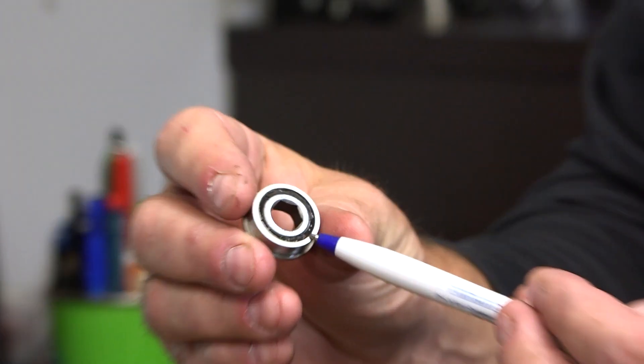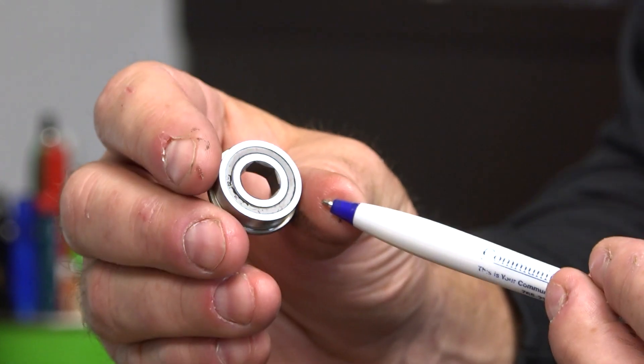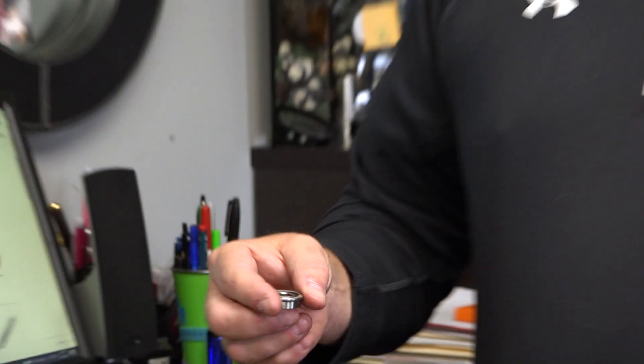There was a problem with it and it started breaking — the inner race was very thin. So we worked all that time diligently to make the inner race thicker so this will work. These are sealed, not shielded, so it's a rubber seal between the inside and outside race — that was part of the design that had to be that way. We're pretty excited about it. We've got a lot of them here and more coming in. It's going to save you weight, it's going to save you space. That's on the new page.